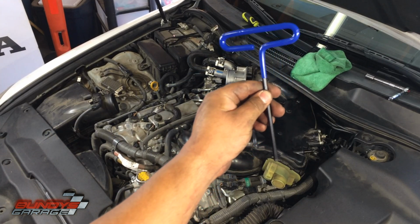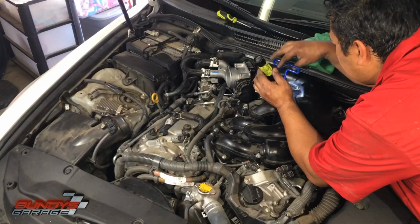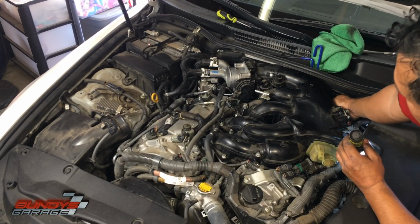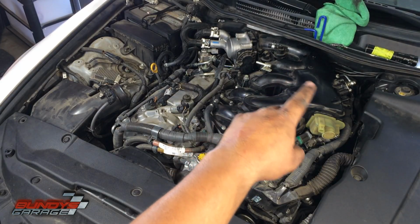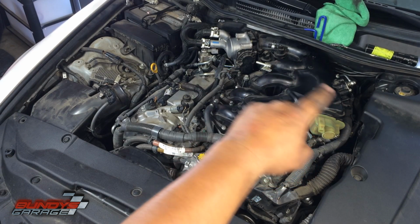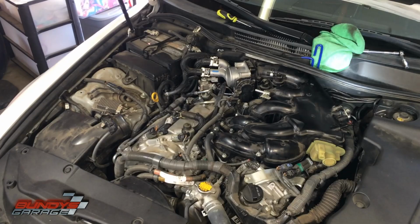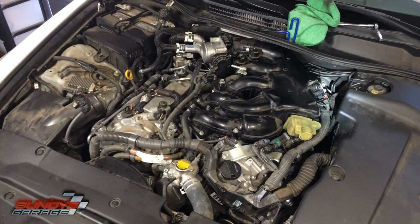Bring in my T-handled Allen key, 5mm. Okay, that one's in place. Go back here, driving this nut. Okay, so got the back bolt done and then got the fuel line back in place. Do the back bolt first before you put the fuel line back into place, because the fuel line covers up the back bolt. So next thing I'm going to do, go back to the fuel system, put in the connector, put in the banjo bolt, make sure both of the washers are there. And I'll come here and tighten that one down.